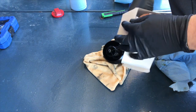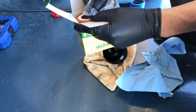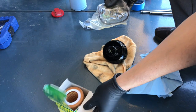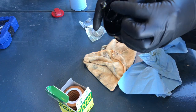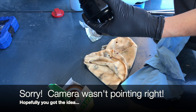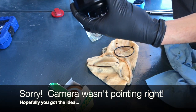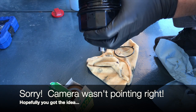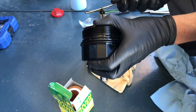In the new filter box when you open it, you'll have a gasket, a copper gasket, a little green gasket, and this gasket. We're going to replace the little rubber seals — this one right here specifically, and this one down here. The way to do this is with a little pick tool. You just come in here and look how easy that is — it just pulls right up. Get in there, give it a good plug, and out it goes.